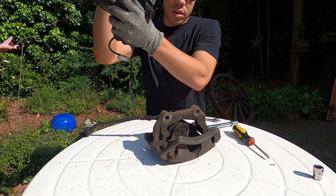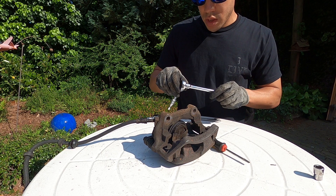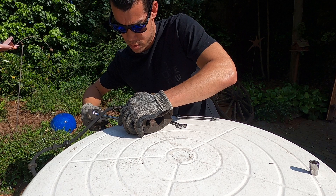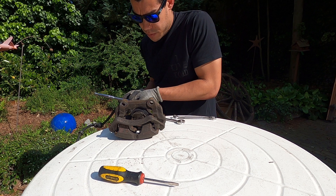We'll also break free and take off the whole brake line. On the back side of the caliper, these two bolts are both 13mm, so we'll start with those to get the thing separated. I wish I had a vice but I don't. There's one — nice — and one more. Got it! Not too bad. Once these slides come out, we'll replace them anyway.